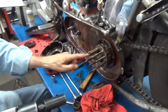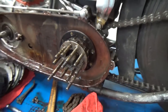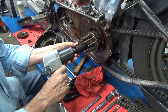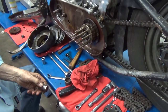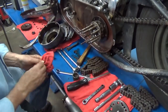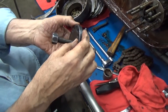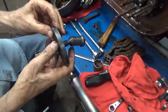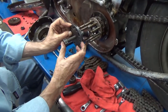The clutch hub nut - this one right here, and it is an early one - is a left hand thread. So we're going to get it loose real quick. That was nice. And now we'll take the appropriate puller. This is for all different models. Years ago I put a little mark here and here and here so I could see the best way it goes on.